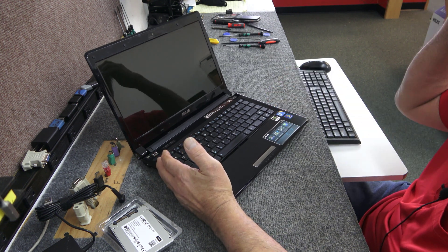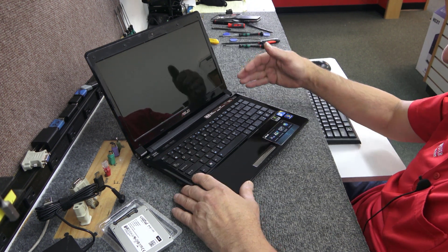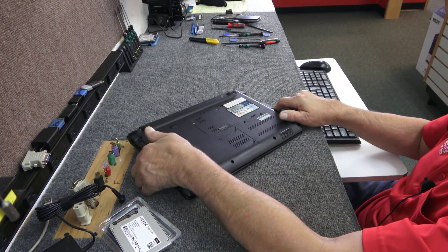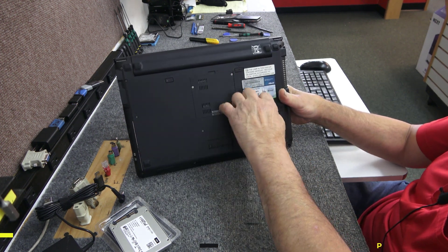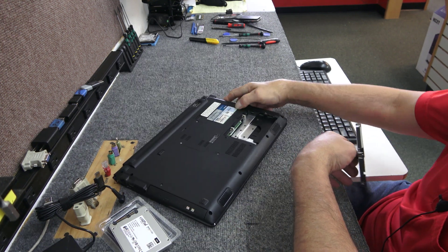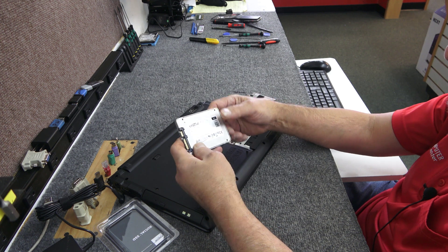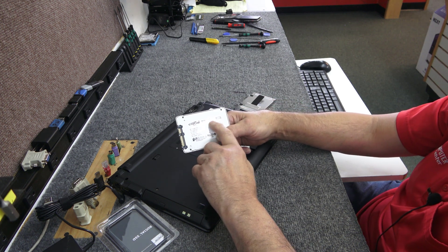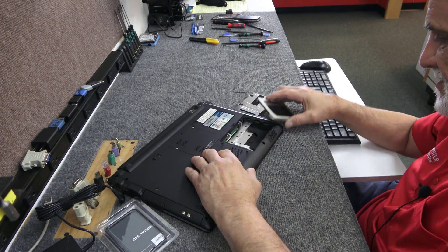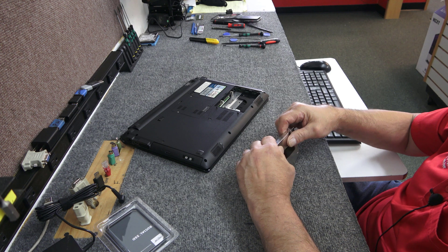It should activate — Microsoft has still been doing that. On the bottom there are only two screws, this little cover pops right off, and that's where the hard drive goes. Here's the empty caddy — it is obviously SATA, and the BIOS does support AHCI, no secure boot or anything like that. Today I'm putting in a brand new Crucial MX500 250GB SSD. It's going to be a lot faster than a clunky old hard drive. First I'm going to mount this in the caddy — pretty simple, just four screws.